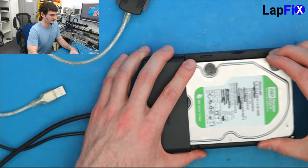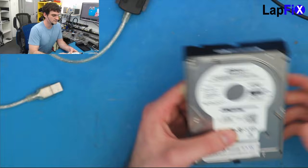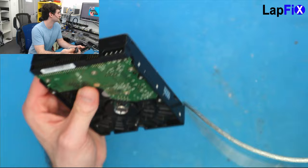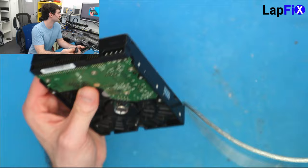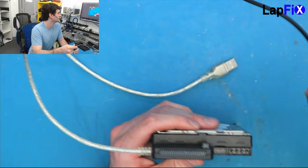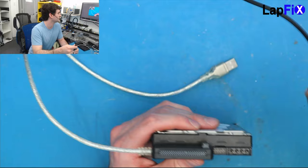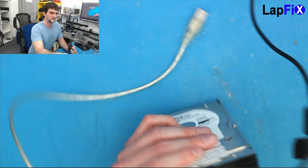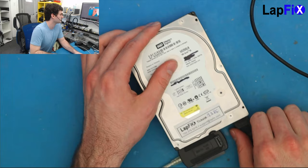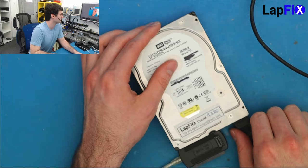Now for this older IDE drive, you need a special type of connection. We have one that does IDE-SATA to USB — that's for data — and also a Molex connection for power. Right when I plug in the Molex, I expect this to at least spin or make some noise — you can usually feel it spin right when you plug in the power. But for this one it's just completely dead. There's no power, nothing. This thing should at least spin right when that power is plugged in, so the board must be the problem.